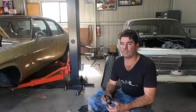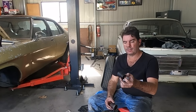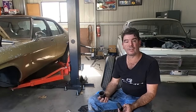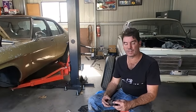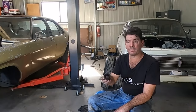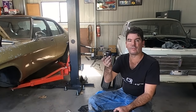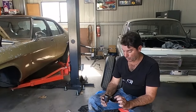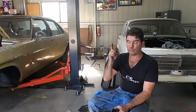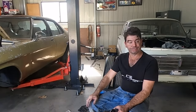The longest part of that job is waiting for the rubber to burn. And I say about transferring heat, there's the inner case of the rubber. It hasn't even melted, so it's really not transferring heat into the control arm. Well, not much anyway. And I like the air chisel. Just go around the edge and work it out. And as I say, there's probably prettier ways, but after that center burnout, to get the cases out, literally took 7 minutes, so that's definitely the fastest way I know. Not the cleanest way, but the fastest way. So anyway, I'll stop talking. We'll get the control arms wire wheeled and start putting the new ones back in.